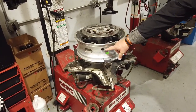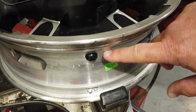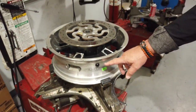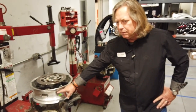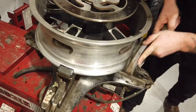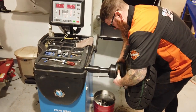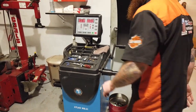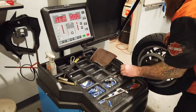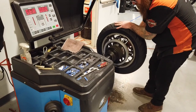One of the things you always want to do when you change a tire is replace the valve stem. This is a very important part of the tire sealing process — that's a giant hole if it isn't sealed properly, and rubber ages with time. Rather than wonder if it's going to hold up for the next 15,000 miles, use a wire brush to get rid of old grime and rubber to make sure the sealing surface is clean. Now we're going to check the balance. This is a pretty expensive balancing machine — it spins around and detects any difference in weight from one side of the wheel to the other, telling us how much weight to add.